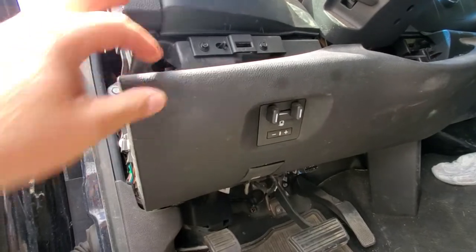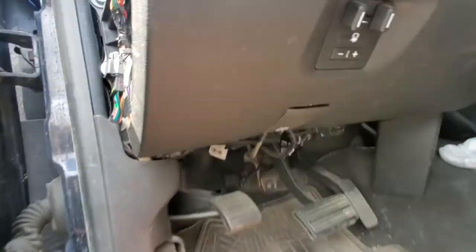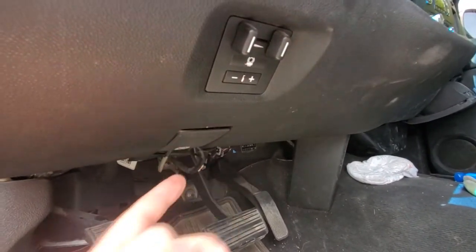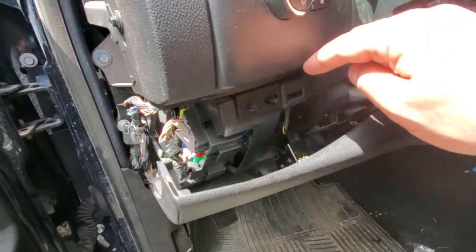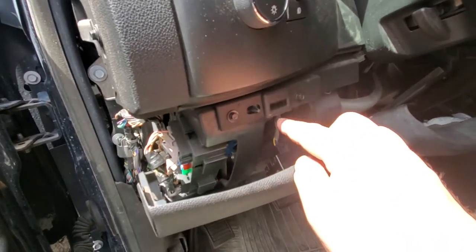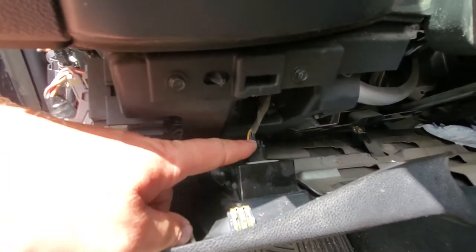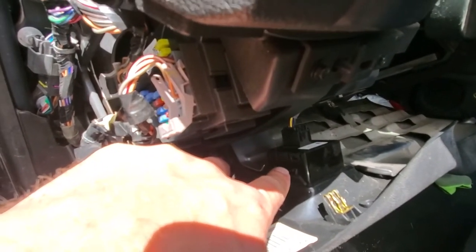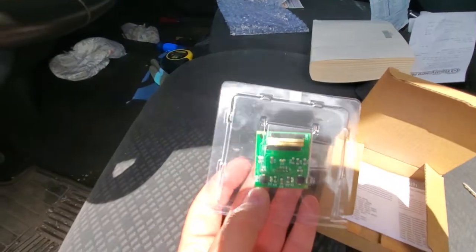To get to the circuit board right here behind the dash, you just take this side cover off — it pulls out — and then there are two black screws, one here and one over here. Where the brake lever is there's a bolt holding that, but I just left that in because you can get to it enough. This trim piece fits right here; just put a screwdriver there and pry it out — it'll pry out these tabs and you can get to it. To replace the circuit board, just undo this pigtail clip, then stick a screwdriver in the little clips on the side and it just pops out. This is what the circuit board looks like, but that ended up not being the problem.